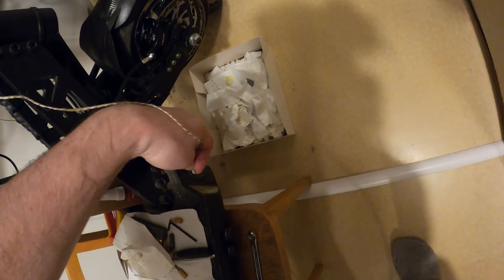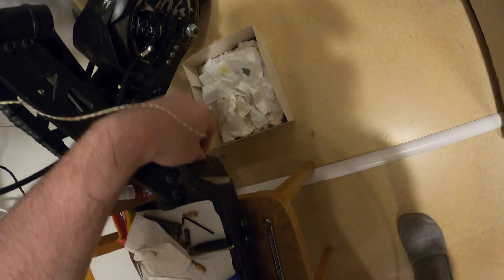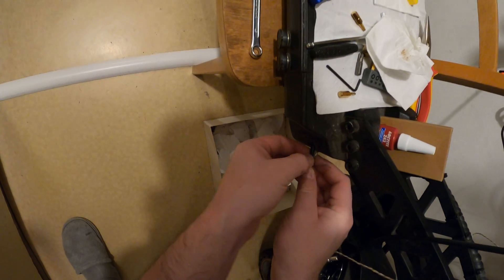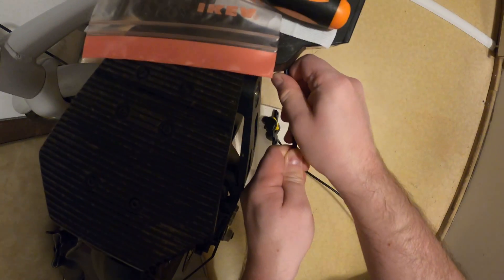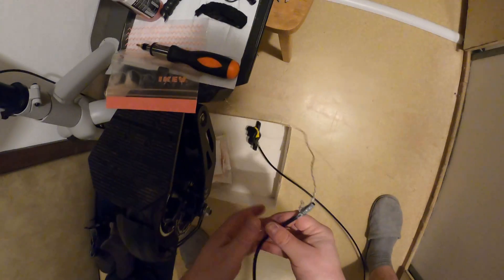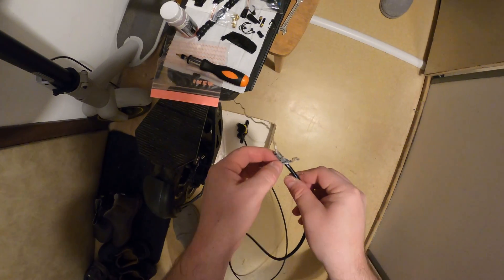In some places, especially if you are pulling the back brake line through the deck, some of the plastic openings might be a bit too tight, so try to carefully push the line through together with the string so the string doesn't come off. On the VDM10 it should fit as you will see in this video. If you are doing this on a different scooter it all depends on how the line goes through the deck — you might be required to remove some parts of the scooter. As you can see, the back plastic piece was a bit stuck but it came through, and putting the string through the stem and deck makes it a lot easier to pull the new line back up.